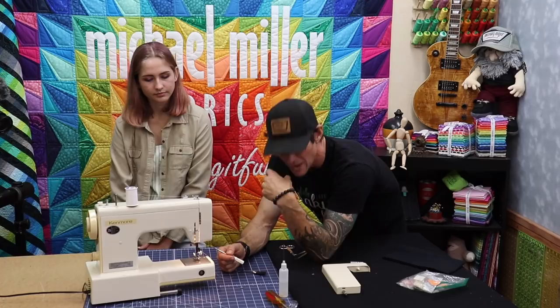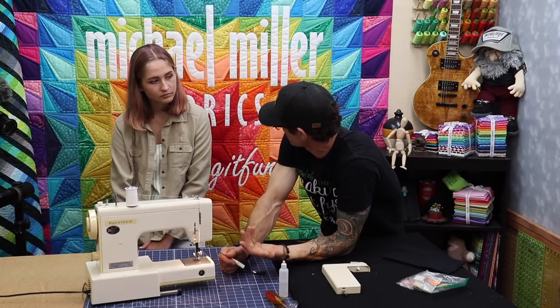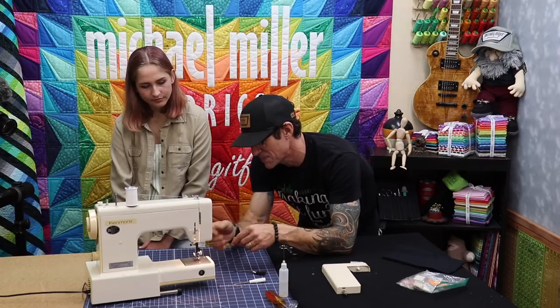Okay. Anytime you're working with these small metal screws, if they're not going in very smoothly, they could be cross-threading. And that can cause them to basically destroy. And these are not screws you'll find commonly in those yellow boxes at Ace Hardware that I love so much. You know, these are something you're going to have to get online, get at a dealership, or get from a salvage yard of old sewing machines a lot of times.